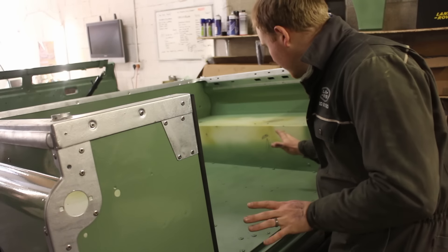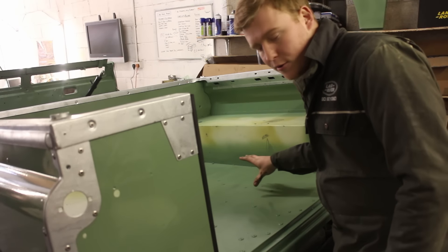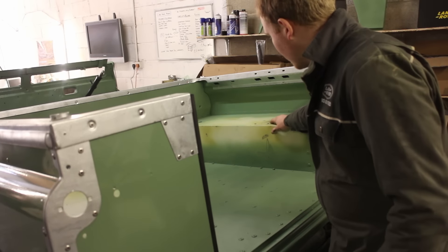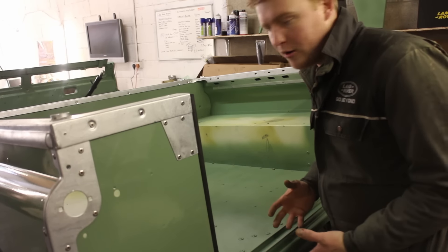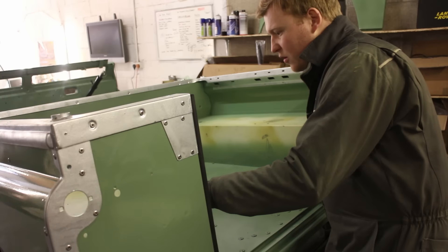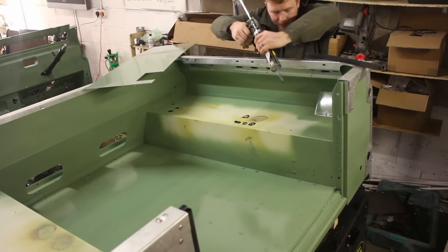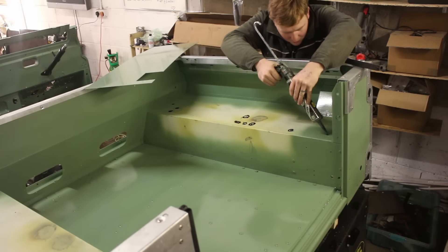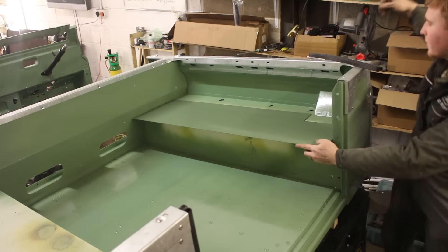Some eagle-eyed viewers last week may have noticed we haven't finished painting the floor of the rear tub because there are a lot of holes in it. While I did show the use of a lumi-weld brazing rod earlier, some of the holes weren't practically repairable, so instead I've created simple 2mm aluminium sheet covers that bolt into place, already painted up. I'm going to put some Sikaflex around the holes to seal them, then place the covering panels on and drill and rivet them in place.